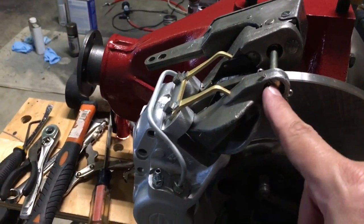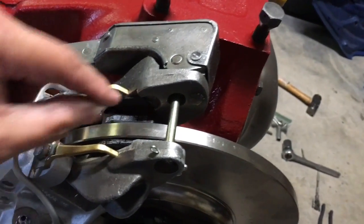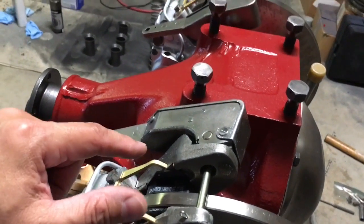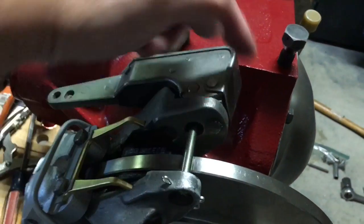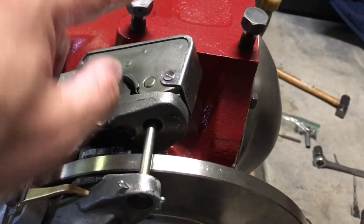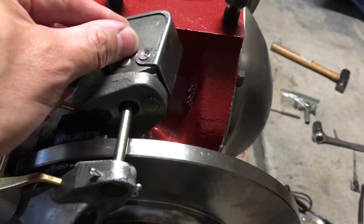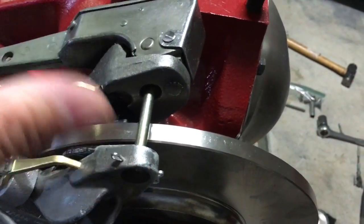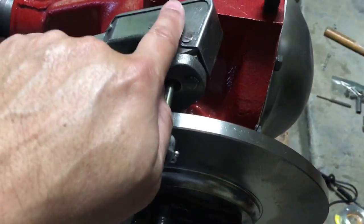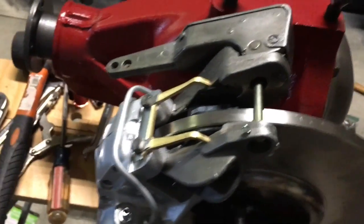You do the initial adjustment with this big screw, and I rebuilt these things multiple times because I got the brake pads backwards. They have a bevel on them the first time. Before you put this cap back on, you have to get this screw into the drum with teeth in it that goes around like a gear. This screws into that, and as it ratchets, the drum turns, which tightens the screw, which puts more pressure on the pads. If you don't get the screw in before you put this on, then when you try to put the screw in, the drum moves around and falls out. So it's all got that silicone grease inside there, so it should be good for a long time. That's where we are.